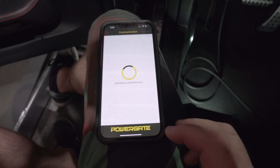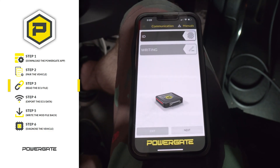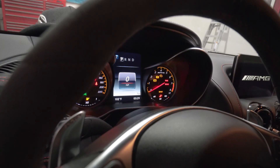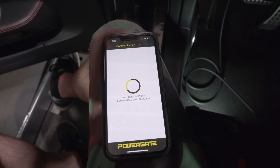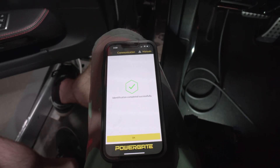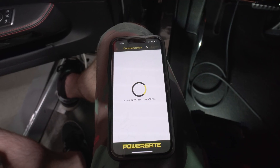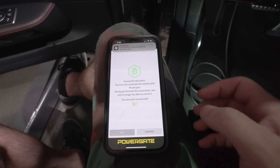Opening that gives us the basic connection info. We continue with the process to read out the ECU — it IDs the software number and provides that so we get the matching original file. We click ID, hit Next, then turn the ignition to the on position so all the dashboard lights are on. ECU identification is in progress, reading out the software number and pulling the original file. It prompts us to turn off the ignition, we do that, and it logs what was processed in case there are any issues to send to AlienTech support. The ID is complete and it's now sending that to our servers.